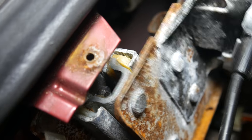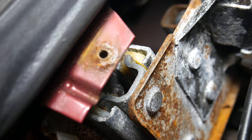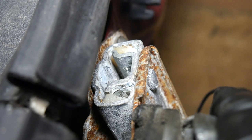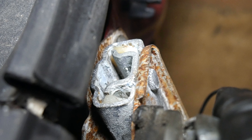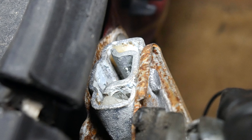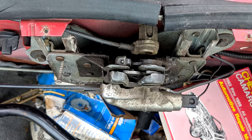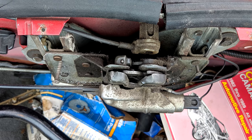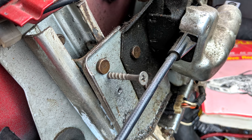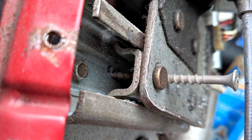In pretty much all of these cars these plastic guides will fall apart with time and use. There are some companies that make aftermarket replacement guides, and we'll install some of those later in this video. Some people who get really fed up will just weld the latch assembly at its lowermost position so the hatch can be opened and closed like any other vehicle. Another solution we happened to see on a 1989 Camaro in a parts yard was to simply ram screws through and lock the assembly down - maybe not the most elegant, but it does appear to do the job and would be easily reversible.